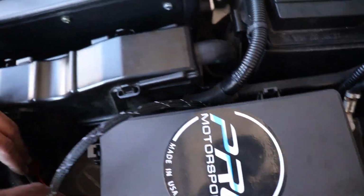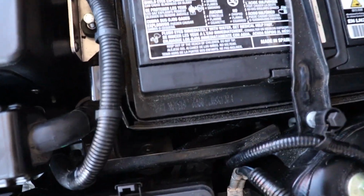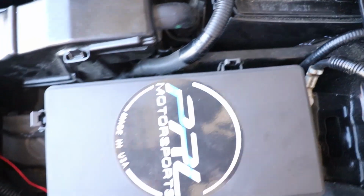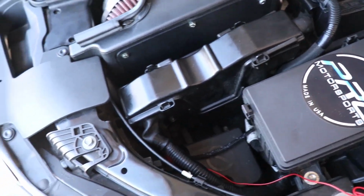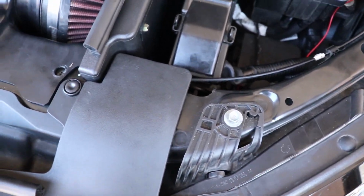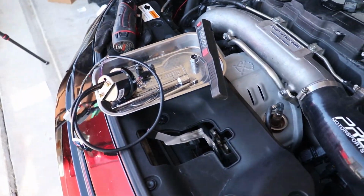So this excess, there was a reason we left this out. It was for whenever we put in the battery, because we did pass it through the battery right there on the side. That way it has room to squeeze and all the good stuff. So put the wires in a safe place, away from the hot spots, basic wiring principle, so to speak. And we'll put the intake back. We're just gonna screw this back down, and then we're gonna go inside the car and put the final.